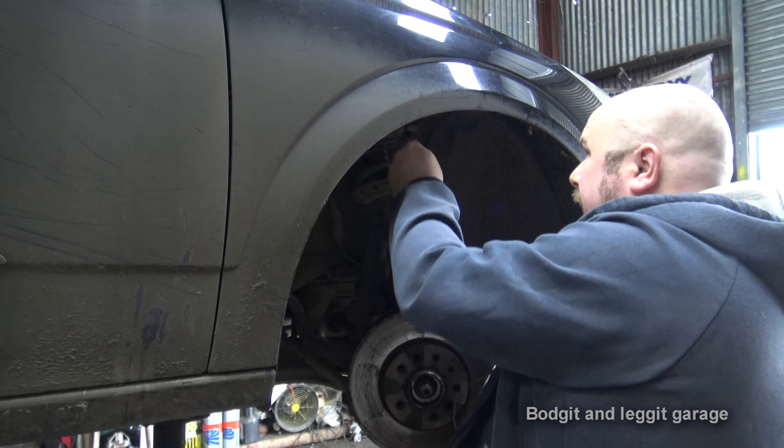Just tighten these fellas back. Those two little dust caps are very important, especially for the allen key bolts — if crap gets in the allen key head you put the allen key in and it doesn't go all the way, and it rounds the head, which makes it very difficult to get the bolt out. So these dust caps are really, really vital.